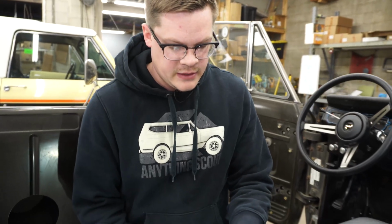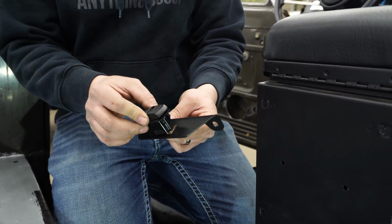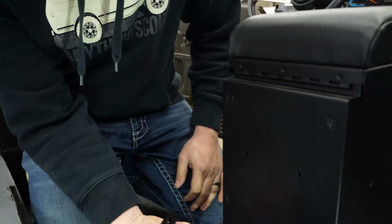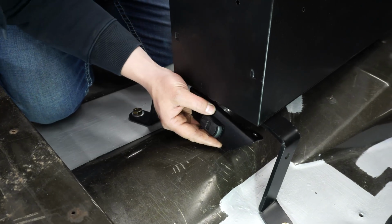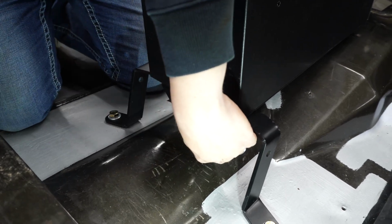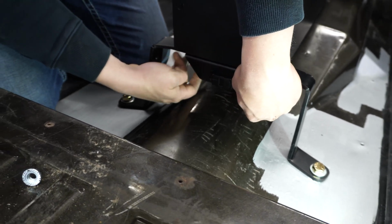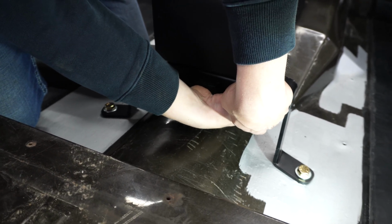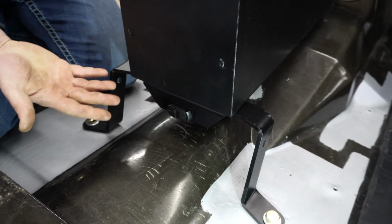Another option you have on our website is the rear charge port holder. Same double USB charger, fits in there pretty nicely, clips right in. These will actually bolt into the rear mounting bolts on the center console, and it just slots right in here. Looks really nice, kind of cleans up the back. If you had any wiring under there, it'll hide that pretty well too. And you'll just reattach the 2 mounting nuts there. Then you'll just snug those up with a wrench or a socket.